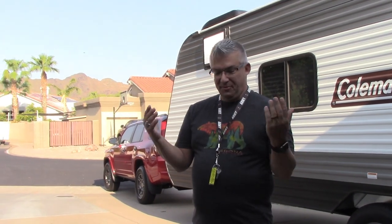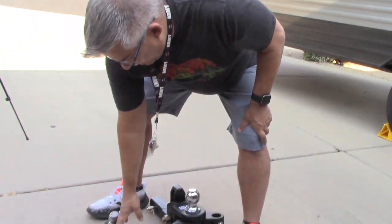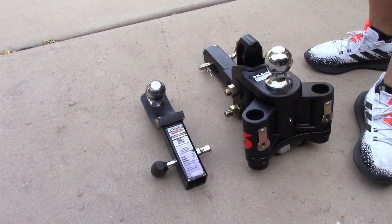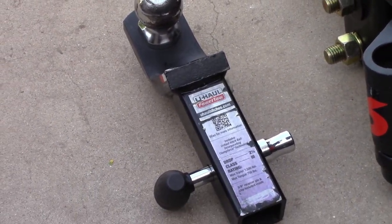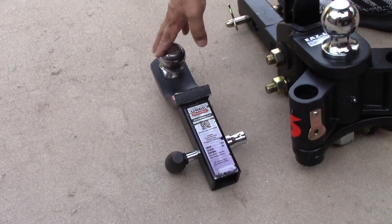When we went to Gander RV to pick up our RV, I said I obviously need a hitch to pull a trailer. Both Ruby the 4Runner and the Palisade have factory installed tow hitches. So we thought we just need a tow receiver piece that goes in there that can carry 5,000 pounds. We went to U-Haul and picked this guy up, which looks pretty beefy. I can pick it up with just a few fingers — it holds 7,500 pounds. The trailer weight is 3,000-something pounds, so 7,500 seemed fine. It has a locking bar so nobody steals it and cost about 40 bucks.